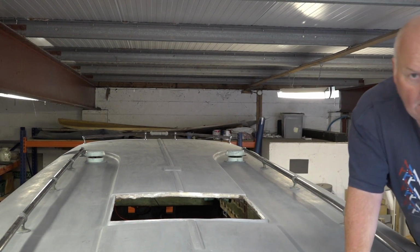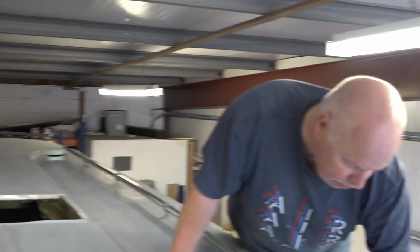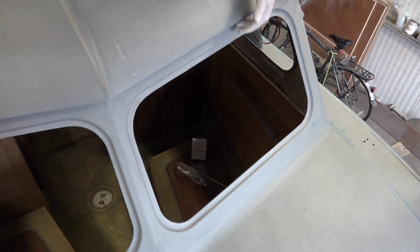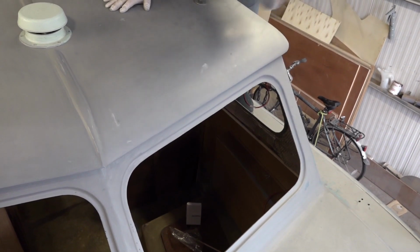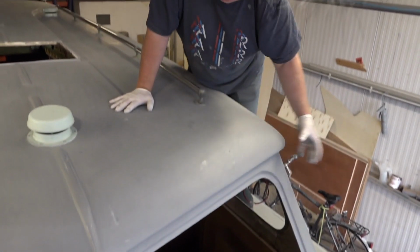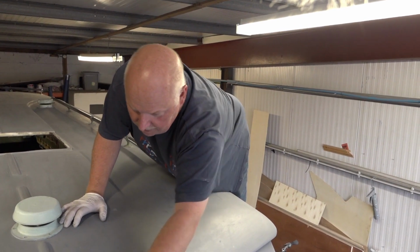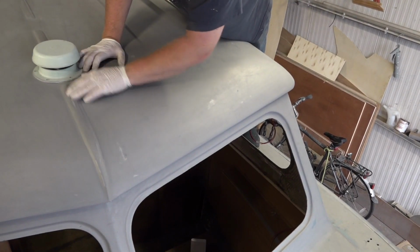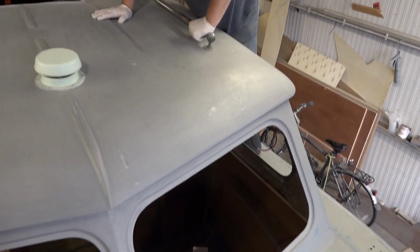Should I go down? Yeah, well, I was just going to show this front edge, and then we can show a shot down there. But we've got a natural finishing edge here, and we have a natural finishing edge on the base of where we're walking at the moment, on the deck side. So we can mask off down there, and I can use that as a finishing edge. I don't even need to mask it because we can roll over and then just paint underneath, and nobody will see it. So that is a great part to do without creating any lines or what have you. But as I said to you, this is a natural edge that goes right to the front. We're fortunate with that because we can get away with a mask line, and then we can use 1200 grade to get rid of it, and hopefully nobody will be any the wiser, and everything should look like glass. So that's what we're going to do.